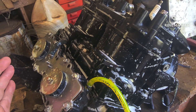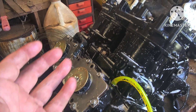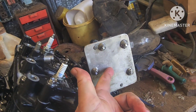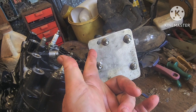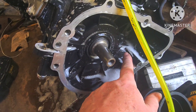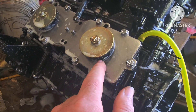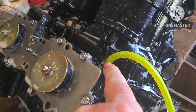You're looking for air bubbles leaking out of your engine, because if you have an air leak on this two-stroke engine you're going to burn up your new build. Your spark plugs have to be tight, everything has to be torqued. I had a special plate made to fit the exhaust and I've used a clear RTV sealant on the back of that. Every place in your case where it fits together, you don't want it blowing bubbles. You may end up getting leaks out of here if you didn't seat these right - this one's got to be seated better, and I've got a leak here.